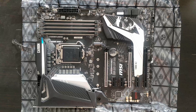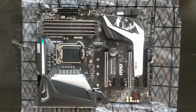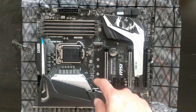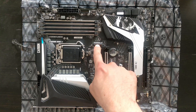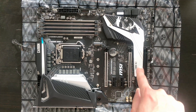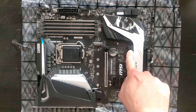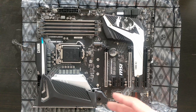This is a pretty good looking motherboard, I've got to admit. We've got four DDR4 slots that go up to 4400MHz, then we've got our CPU socket. This one supports 8th and 9th gen Core, Pentium Gold, and Celeron depending on your needs. Then we've got the first M.2 slot, and hidden behind this shield — you can remove the screw — there's another M.2 slot.